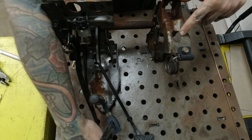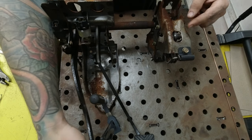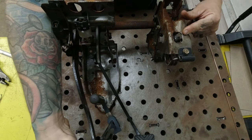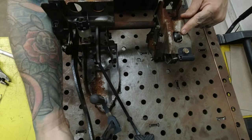I've got about two inches of pedal travel and then it finally moves. It's going pretty hard because there's no pressure from a master cylinder. So you can tell I've got to move it quite a bit before it ever gets to moving any master cylinder — that's the issue right there.